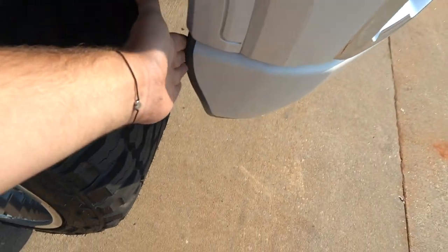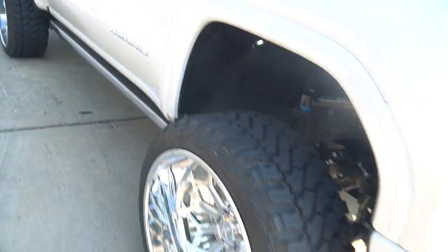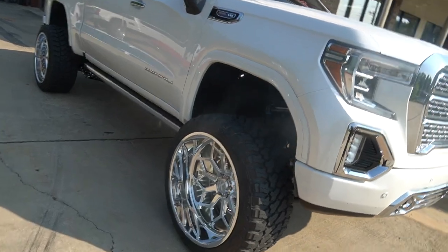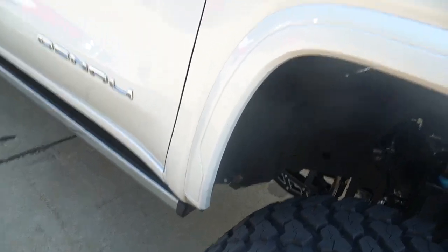Trim the front bumper a little bit, cover it up with some door trim, take the mud flap off in the back, trim that bracket off, and then we push the fender liner back and cover it up with some door trim. Depending on the truck, we may paint a little bit. Depending on the truck, we don't want to mess up paint. We're definitely not body guys here, so we don't clean the area underneath the trim piece just because we don't want to mess up anything underneath.